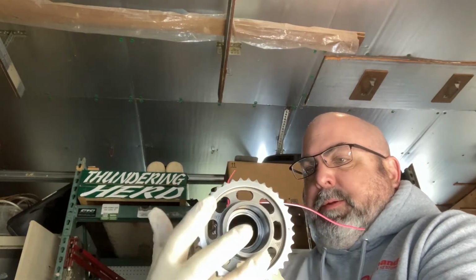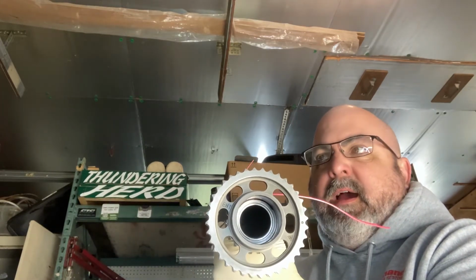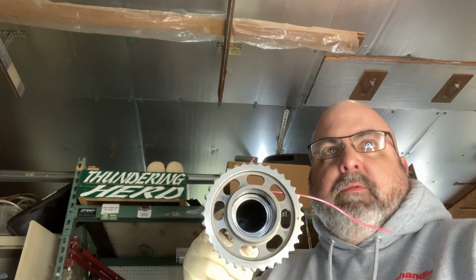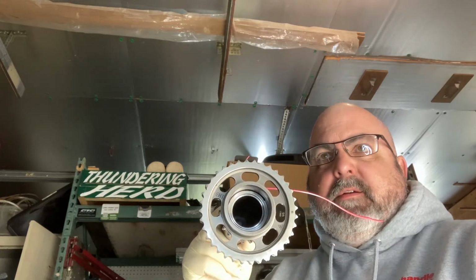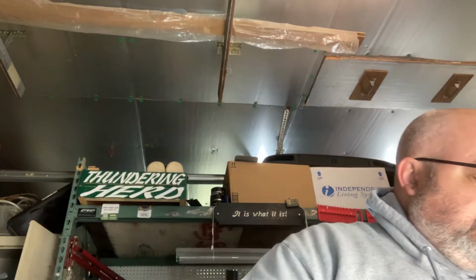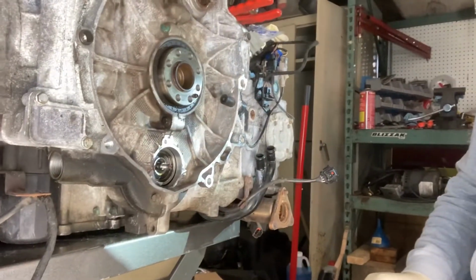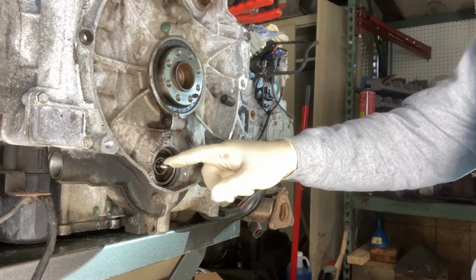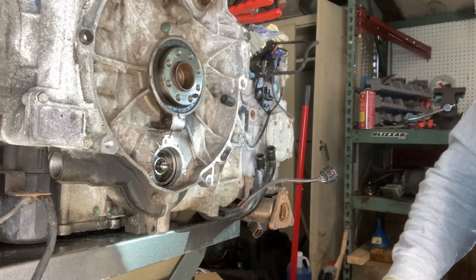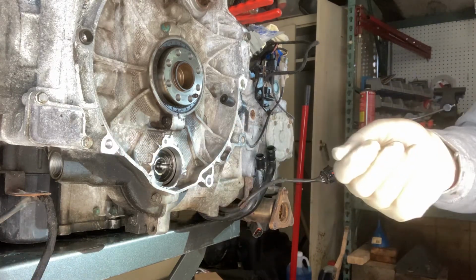But you know, as long as the stud coming through the bearing's in good shape, which this being a 99, it was a double row bearing, and it was a much heftier stud. Again, numerous discussions online about, you know, the 99s weren't the quote-unquote problem year because they had a heftier stud. Turning around here, this is the stud that I'm referring to that comes through the back side of the bearing, and we're actually using that stud in the blank to push the bearing out by pulling on it out here.